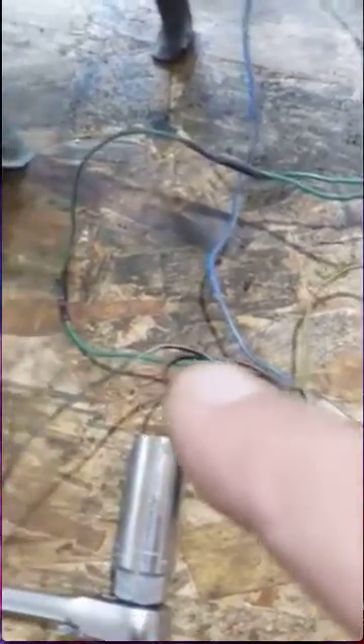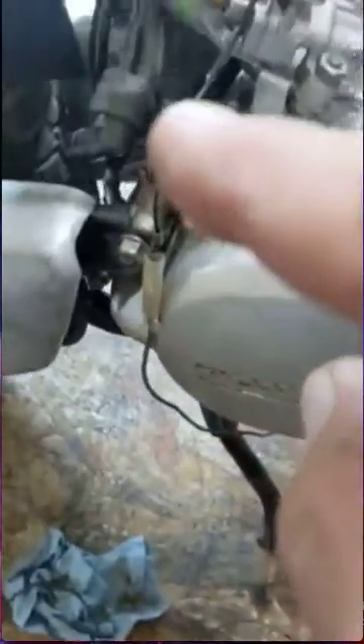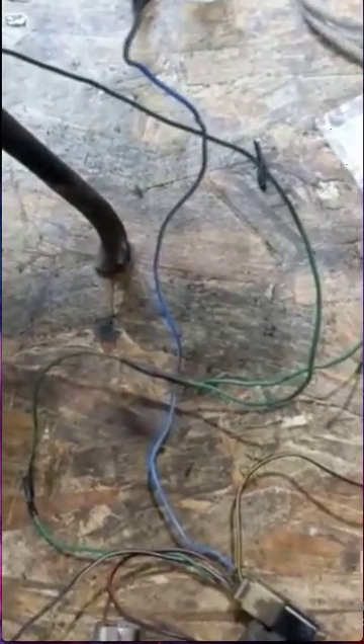And, as you can see, we've got a ground wire running from the CDI, and that connects into the ground wire off the engine. And also the coil is grounded to the same. So, you were correct — you do need the black and red for a complete circuit.